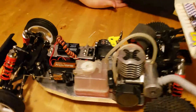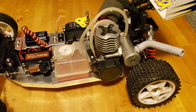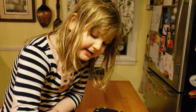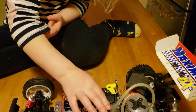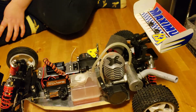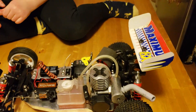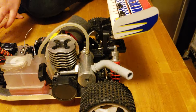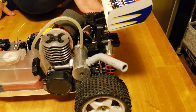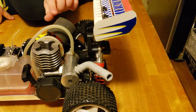It's got this fuel tank. You know where the fuel tank is. It's got the fuel in it - it's clear and it has like a priming button right there. That is called the priming button - if you push it, that pushes fuel into the engine to make it easier to start. You don't see that on a lot of newer cars. Engine is made by Duratrax as well. They call it Torque with a Q. Size is .12, and it's one of the most reliable glow engines I've ever dealt with.